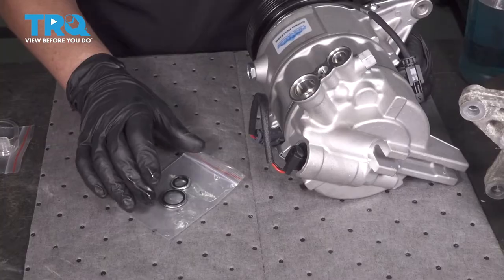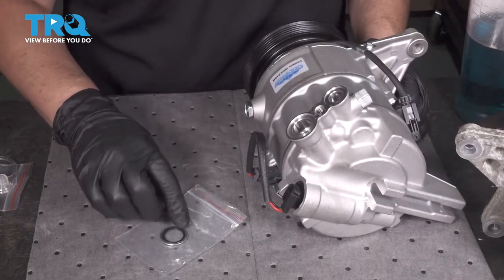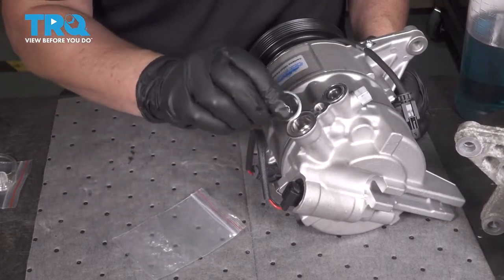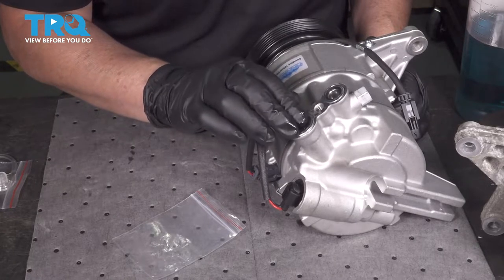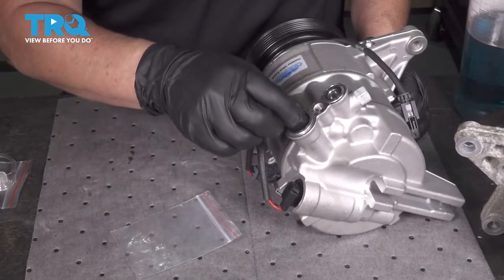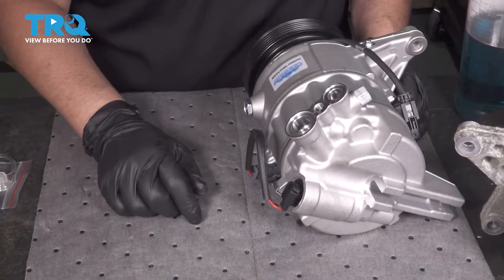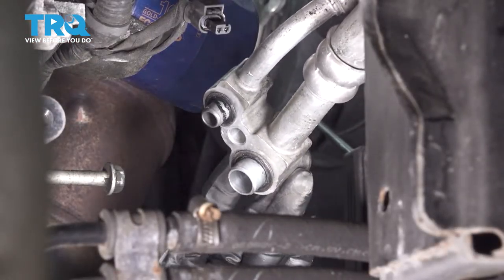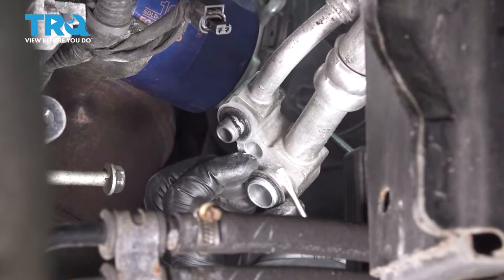They supply new seals, which is perfect. Before assembling, these are going to go on the line after I clean it up and take the old ones off. I want to make sure they're correct — just plop them in the center to make sure they seat correctly and aren't overlapped. You don't want one that's too big and sticking out like that — it's going to leak. Those look good. Now I'm going to remove those, get them ready for installation on the actual line. Here is the AC line where the compressor goes — I'm going to take the old seals off with a little flat screwdriver and peel those old seals right off.